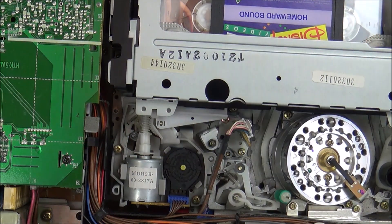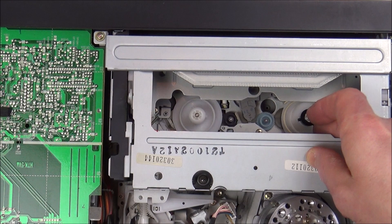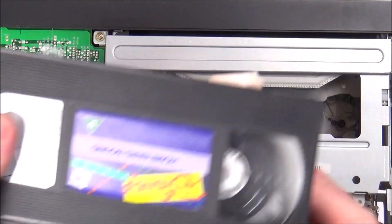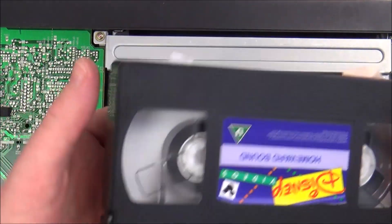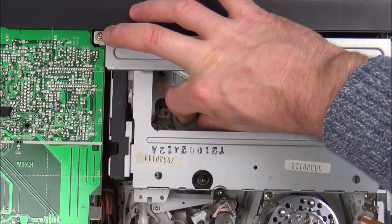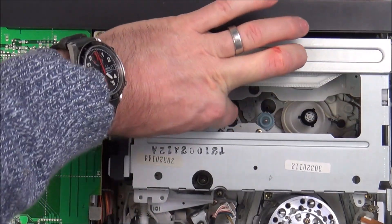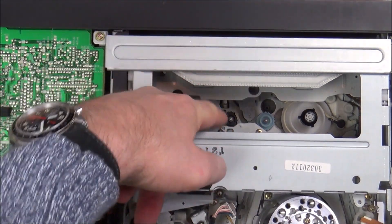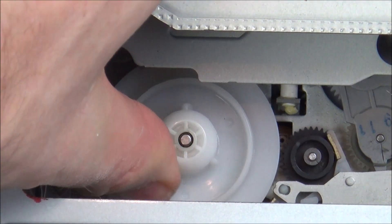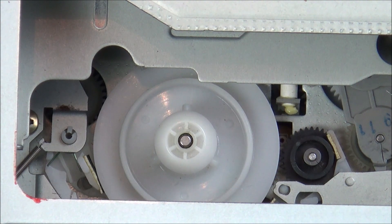I'm going to concentrate more on the actual spindles rather than the capstan roller. I want to see why that's not turning. This one appears to be turning okay — it's pushing the tape around. But for some reason this one here is not being wound on. This needs to be moving this way, and it's not. It does feel particularly stiff. I can see it's turning the cog next to it, and turning that one there. I think I need to try to understand how this mechanism works — maybe it's not electrical, maybe it is mechanical.